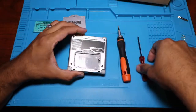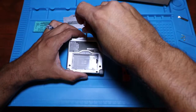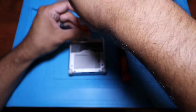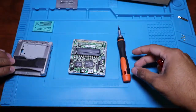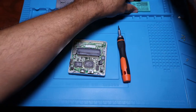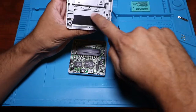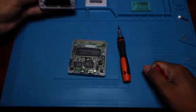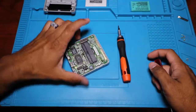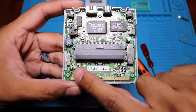Once the battery is off, you're going to want to take off these two screws here. Again, use your tri-wing screwdriver, remove these two and the case should come apart. Make sure you're putting your screws in certain areas so that way you know where they're at. As you can see, we opened up the case — one side has the board and everything, the other side is just going to be the shell. Be careful of that little square nut which holds the screw for the battery cover. If you purchase a new case it should come with a new set, so don't worry if you lose it.